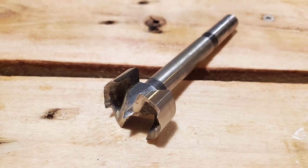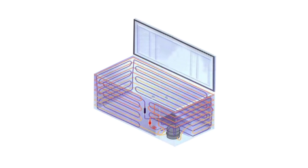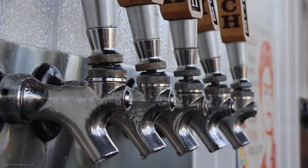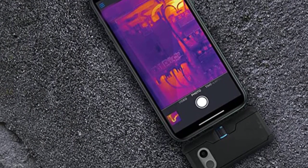You'll also need a one inch Forstner bit or hole saw. Before you drill any holes in your freezer, make sure you know where the coolant lines are. You can look for a schematic diagram of your freezer or check online for resources to help you locate coolant lines. It's a common issue when building a kegerator, or you can borrow a thermal imaging camera. You can see the heat signature of the coolant lines on the upper walls of my freezer. The bottom looks clear and an inside view also confirms that there are no coolant lines in the floor, so I should be good to go.